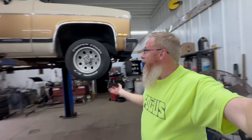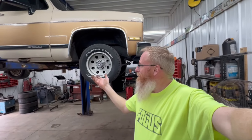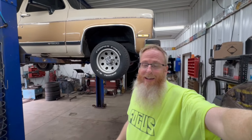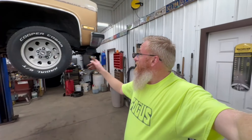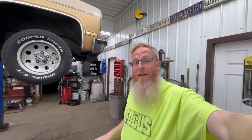Overall so far I'm not disappointed. Everything that I knew was wrong is wrong — maybe a little bit more on that back tailgate area, but we've got everything we need coming, compliments of AMD. Now we're going to get this thing down to eye level and give that front end a shake. Check the ball joints, check the tie rods, make sure everything's there, because our shake could be coming from a bad tie rod, wheel bearing, or ball joint.